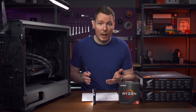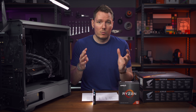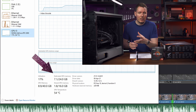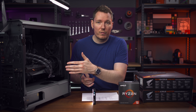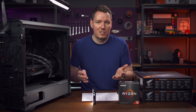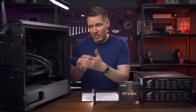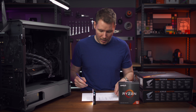I still want to do a comparison between a 3090 and a 3080, but I haven't been able to get my hands on a 3080. I would say it just comes down to VRAM. If whatever project you're working on is effects-intensive or you're using really high-resolution files, bring up your task manager and see how much VRAM you're using. If the 10GB that comes with the 3080 is plenty, that's probably the better choice. If you need more VRAM, the 3090 is really the best option. It was also just easier to get a 3090 than a 3080.